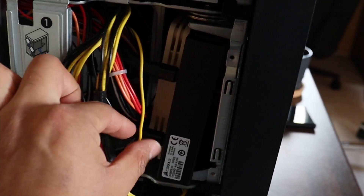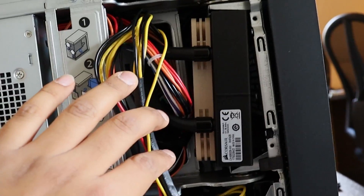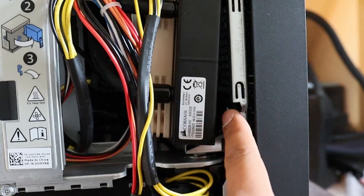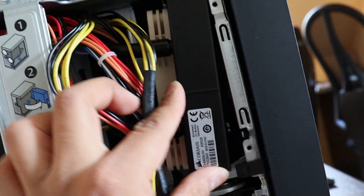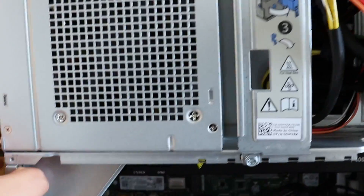Let me show you how it looks. This is the Corsair H60, and this is the Noctua fan here. The 15mm thickness helps a lot in order to fit perfectly. If you have the 3640 model, there is no need to bend this piece of metal — in the forum post, that user shows he needed to bend the metal to fit the radiator on the 3630, but on the 3640 the radiator just fits perfectly and is pretty stable. There is no need to damage your case or make any modifications.